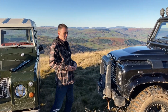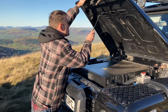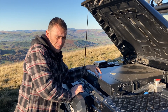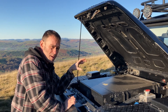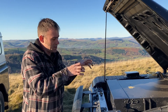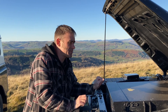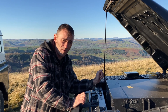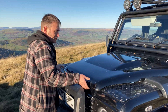A lot of you are probably familiar with this old beast from other videos. Just to recap: it's got a 60 kilowatt hour Tesla battery pack in the front and a 40 kilowatt hour in the rear, so that's a 100 kilowatt hour battery pack total. It's got a Tesla drive unit mid-mounted underneath the chassis rails that drives the front and rear prop shafts. It's got a limited slip diff in each axle, and the Tesla unit — so that's three LSDs, or ATBs, automatic torque biasing diffs — which make this an absolute monster off-road.